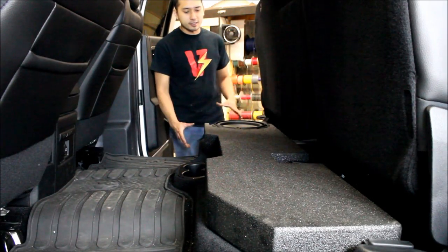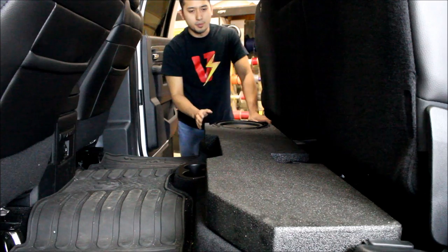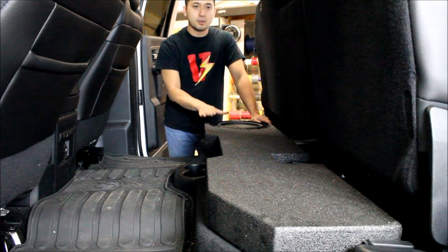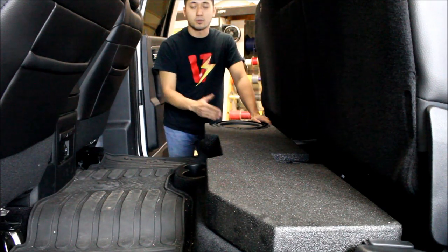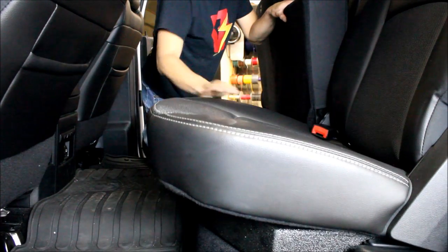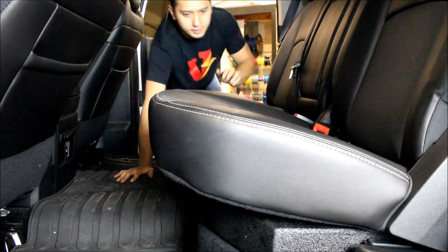We now have the vented version in. As you can see it is the least practical version because we've lost all cargo-carrying capabilities in the back, but we have a lot more output with the vented enclosure and we actually don't need as much power to run the woofer. I'd still recommend matching the woofer to the amp — so if it's 300 watts RMS, get a 300-watt RMS amplifier or a little higher for headroom. As far as fitment goes, it fits pretty good. This is thicker than the other ATRENDs so you'll have to settle it in over time, but it fits reasonably well.